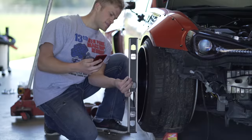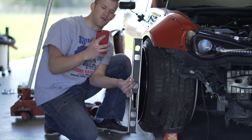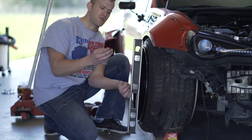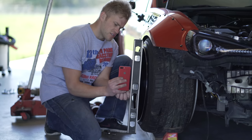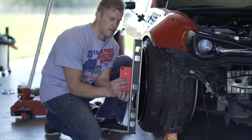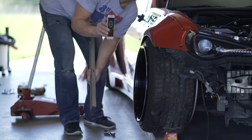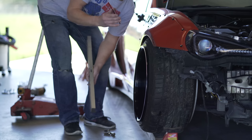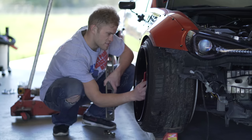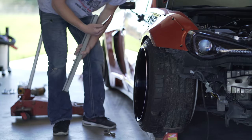So what I'm doing right now guys is just checking my camber, and I actually have this app on my phone — it's called Pocket Pit. All you need to do is use it on the edge of your wheel, or what I like to do is use a straight edge on my wheel. I'm running 5.2 degrees camber on the front. This app is called Pocket Pit and they have a camber gauge right on here. It's super sick guys, I'd highly suggest downloading it — it's free. You can even go up to random people's cars and measure them if you want.